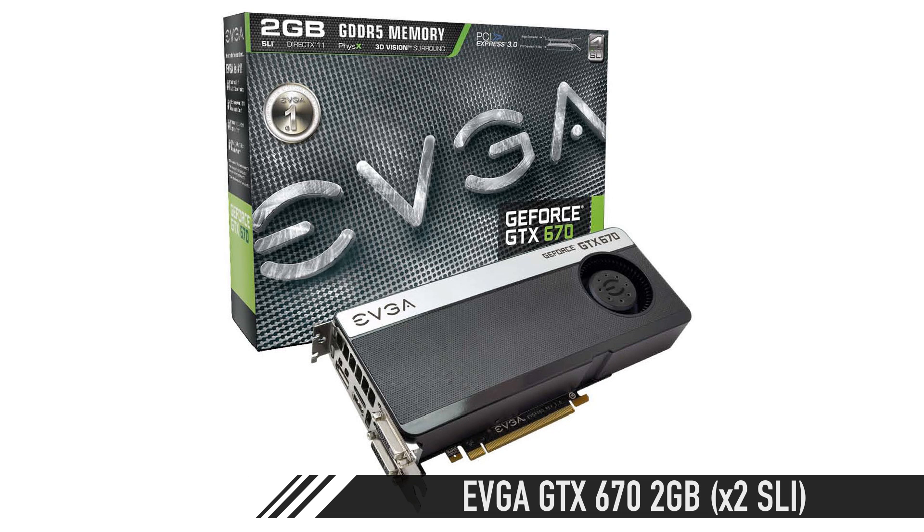For the video card, we can either get two GTX 680s or two GTX 670s — I'm going with two GTX 670s. There will be a few less CUDA cores, but the speed is going to be incredible. You can grab the 680s if you want and it'll still come out under $5,000. I'm going with EVGA — there are good prices on the SuperClocked and For The Win editions. Make sure you get the versions with the backplate; it reduces temps by 4 or 5 degrees and the large exhaust holes on the bracket help too. These cards are very overclockable and stable, and I love EVGA's warranty.